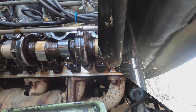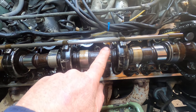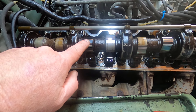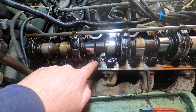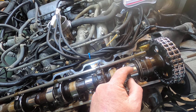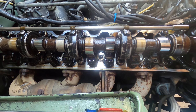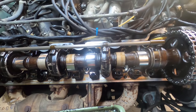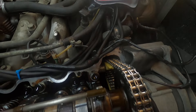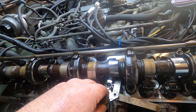After rotating just a little, I've got two I can check. This one right here is an exhaust — you can tell because it's right over an exhaust pipe. This one over here is an intake, its neighbor being exhaust. You'll have different measurements for each: the exhaust is going to be 0.008 inches cold and the intake is going to be 0.004 inches cold. This engine is stone cold.